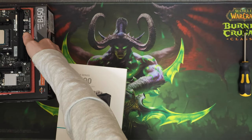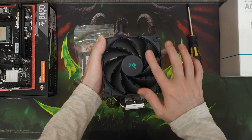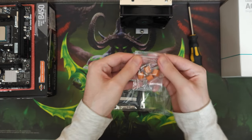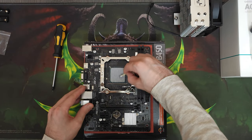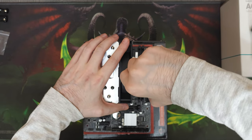Anyhow, we'll be cooling our CPU with the Deepcool AG400. We bought this cooler in a local shop for about 20 US dollars. By the way, if you guys are ever confused about which brackets or nuts to use for which socket, the orange ones in Deepcool products are usually for AMD. We'll be applying GD900 thermal paste on this CPU.